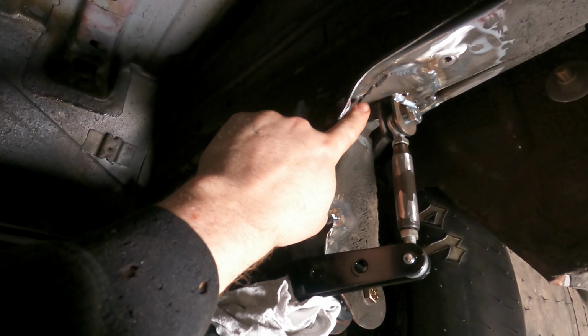Now, we also know that at the bottom height of that intercooler right now, we can mount the rad at the same height and we'll be well below the hood. So best case scenario, we can put a taller rad in the car, but at least we know that the one that's here will fit no matter what. So as you can see, this is behind the factory frame rail right there, about an inch and a half to 2 inches. And then what I wanna do, like I mentioned, was run a 1 1/4 inch tube here. It'll bend just underneath, and then we'll come off of it to grab that mount and this mount here. So what we need to do is go grab our little cheater stick and we'll put that up there. That'll tell us how much material we need and we can start bending.